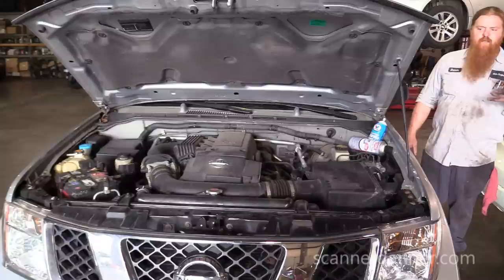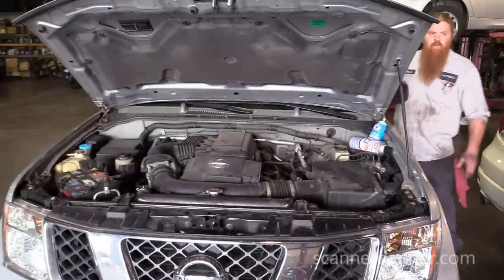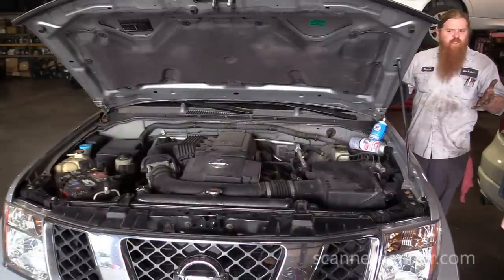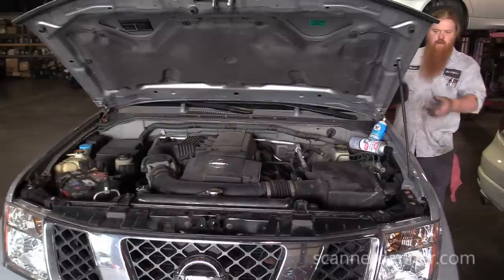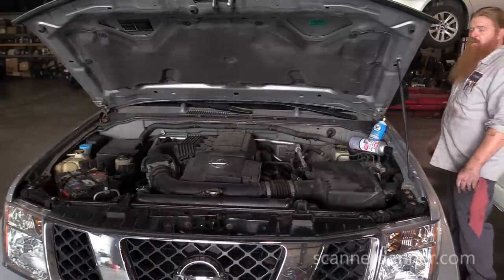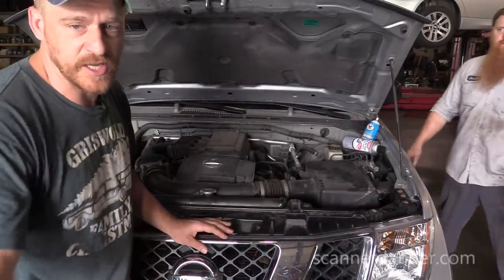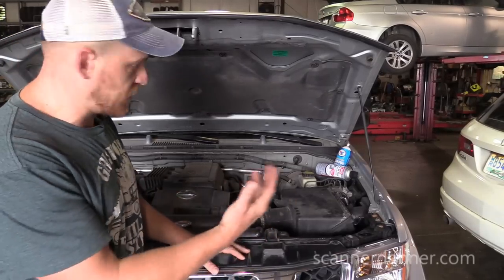It flares up and then it just starts falling. It'll start up the next time around. The car is really nice for a second, and then if you get in there and try to give it gas, it won't do it. Guys, let's make sure these guys are clear on that. This is a pretty standard symptom of a fuel delivery problem. That's what Danner was thinking about when he initially started his diagnosis, and then put some fuel in.